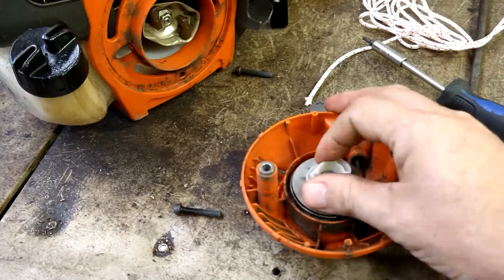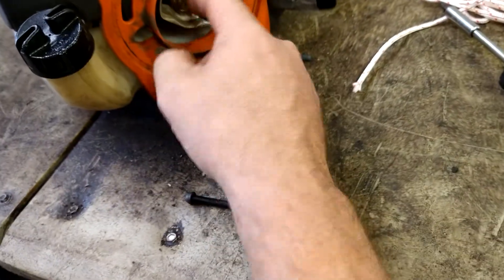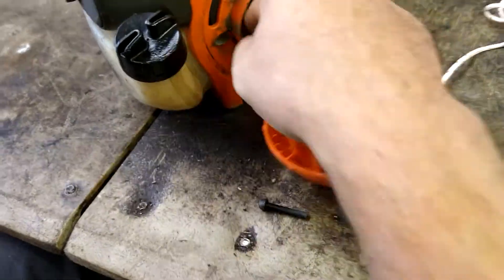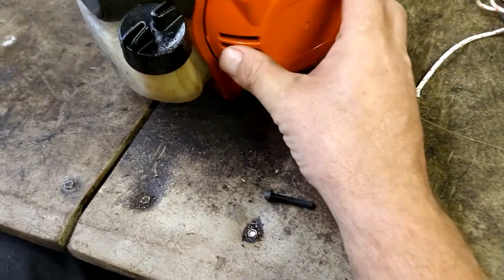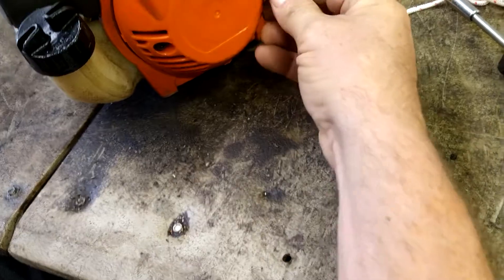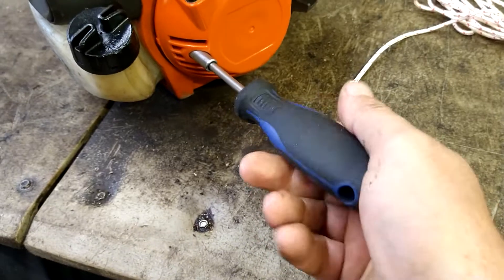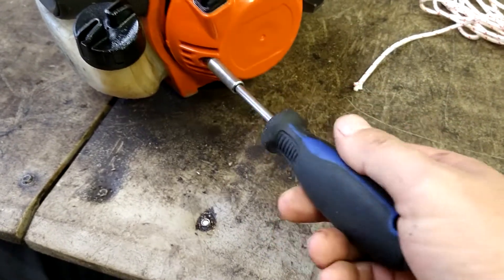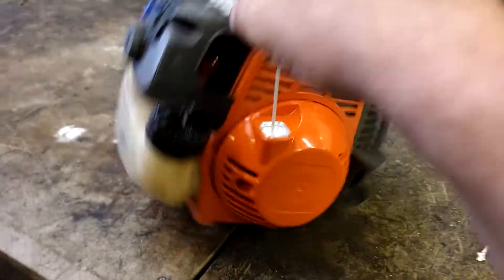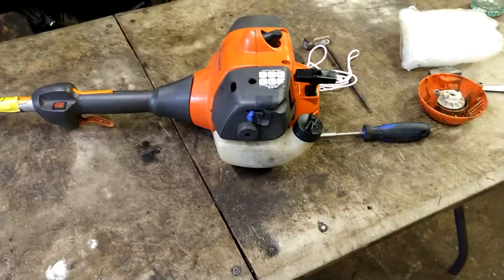It's not engaging — that's the broken spring. The pawls are working fine. Pawls are spelled P-A-W-L. Put part one in, part two in, tighten them both down — way easier to do it this way. And it's engaging now. Let me start her up and see if she runs.